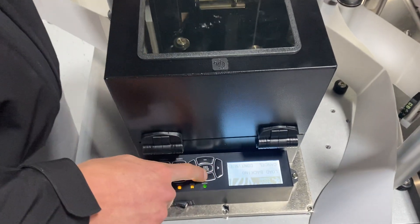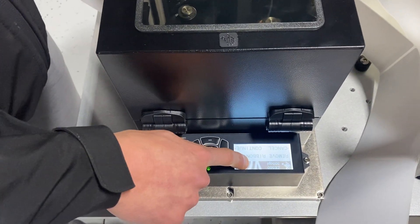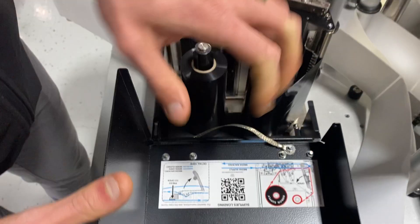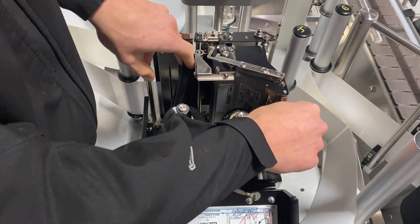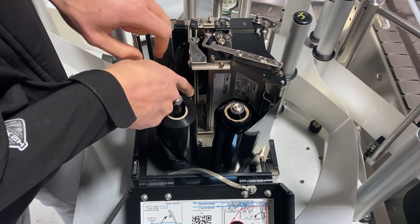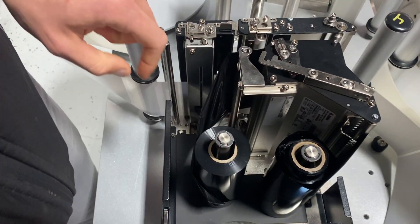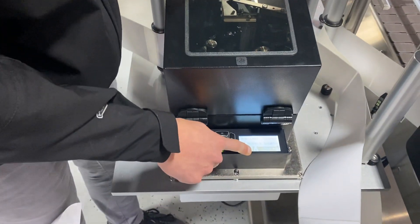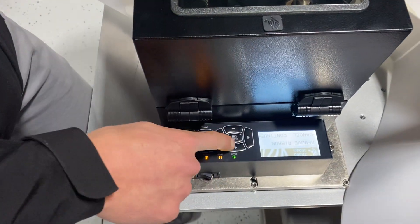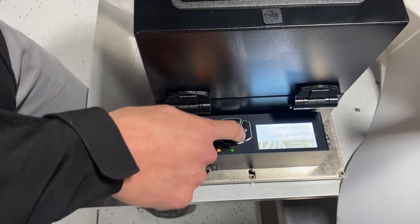To continue, hit the plus button — it says 'remove ribbon.' You can remove the entire spool of ribbon, but the easier thing to do is just pull the ribbon away from the ribbon sensor at the back end of the printer so that it doesn't detect it. It will then ask you to continue again — hit the plus button.